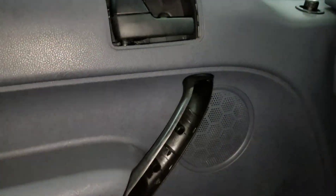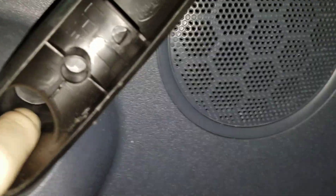On this one there are also a number of different screws along the side that we're going to remove, and then we should be able to pop this door panel off. We'll also remove this little plastic piece off the inner door handle, and there are a couple more screws inside — one here and one here. This is typically very similar on all different makes and models.